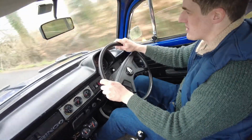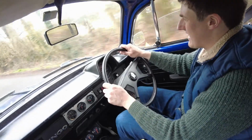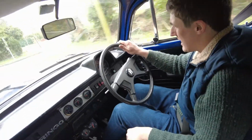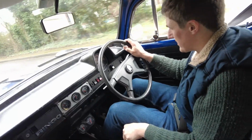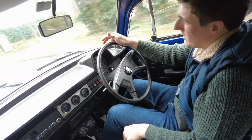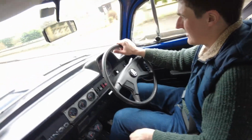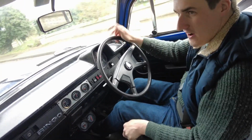By the way, tyre pressures are something very important to keep on top of in Beetles. They just seem to be very pernickety about the tyre pressure being right. They handle like a dog if the tyre pressure's anyway wrong. So I have an 18 on the front and 27 on the rear, and it seems to be right for this car as well. I know it sounds very low, but...